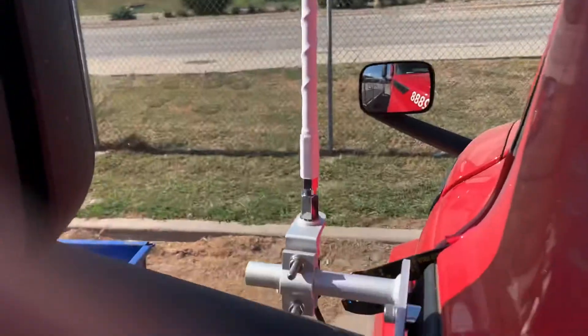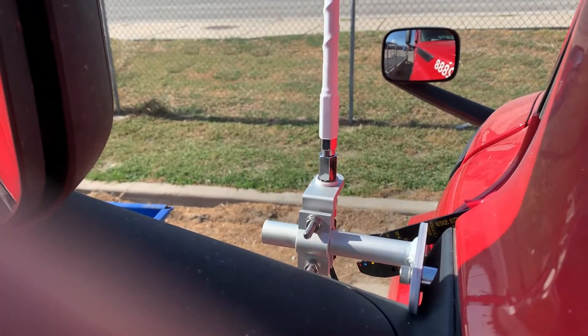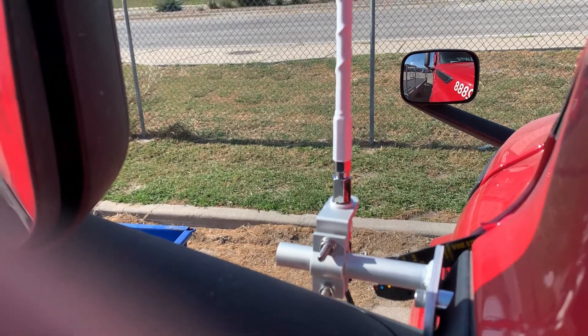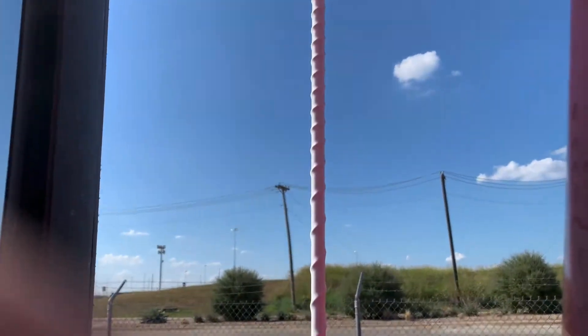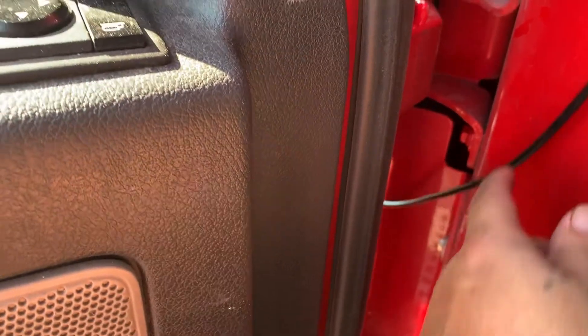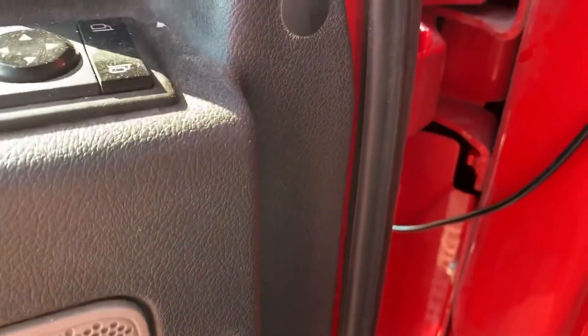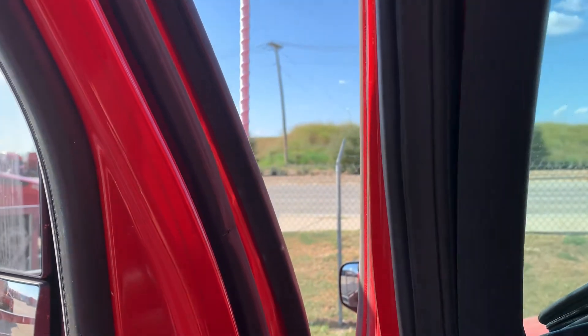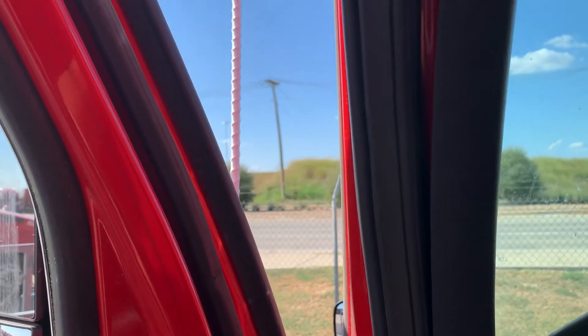It's just a regular fire stick antenna. I don't kick mine forward — I work for Creek Carriers and my truck is not fast enough to straighten the antenna out, so I run mine straight up and down. It's a top load so I want it up high. I bring my cable right through there, and even with the door shut there's still slack on it. I come up this side, right here up this seam — if you pull on this seam it just comes right out.